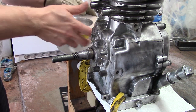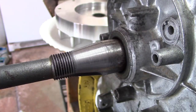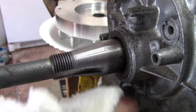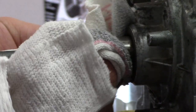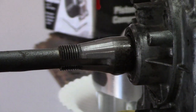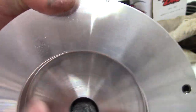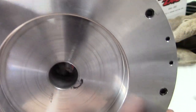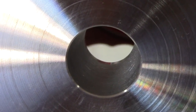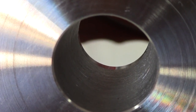If you want to know where to get valve grinding compound, flywheel, or any of the tools, I have the product links in the description. After you get all of that valve grinding compound off — you've basically had liquid sandpaper on your metal pieces — you want to make sure it's all off. I'm using brake cleaner or carb cleaner to spray it off. Use a white cotton rag so you can see if there's any residual compound. Once it's clean and you can see the mating surfaces are roughed up, you're ready to move on to the next step.